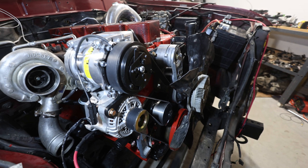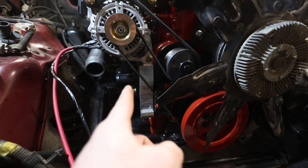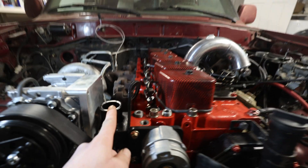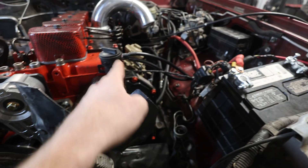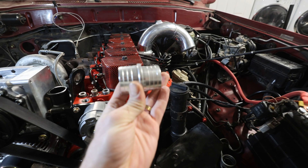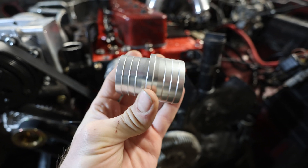This is a nice bracket option for any swap, but particularly for the 80 series — it cleans up the whole area and allows for intercooler and water outlet plumbing with a one and a half inch outlet that plumbs right into the Toyota radiator. We'll need a 1.75 or possibly 2-inch hose from the water inlet pipe, a 90-degree crossing over while checking for interference with the oil fill tube, then a one and a half inch into the Toyota radiator. We have a coupler going from 1.75 to 1.5 inches to make those different sizes work — probably a good idea to buy two in case one fails on the trail.